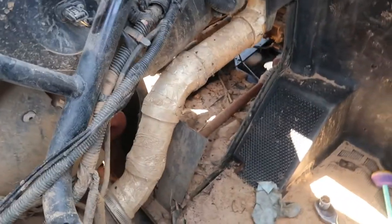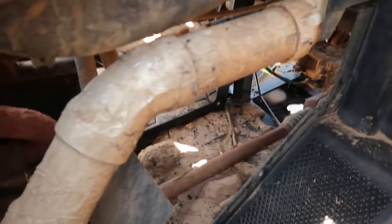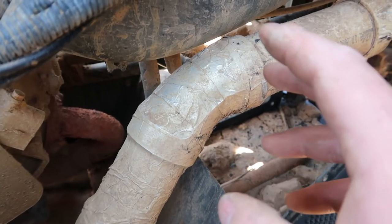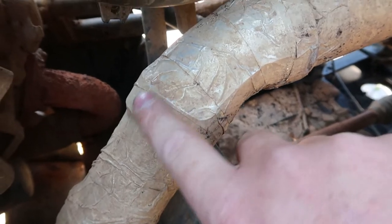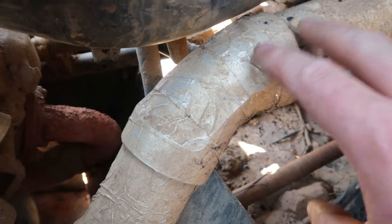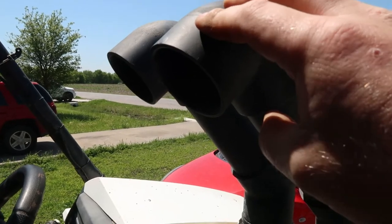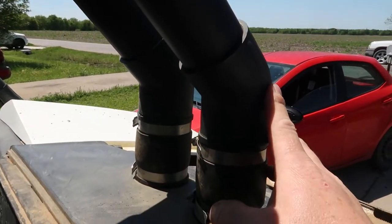In the parts list you'll see mention of water 90s and drain fittings and water fittings. Basically the difference is water fittings are a slightly different size and angle, so for really tight spots they work out really well, and for the risers they just look better. The drain fittings — you can see there's a little bit of a dip and some texture to it. These are usually cheaper at Home Depot. The water fittings — see how it's just real smooth on the outside, no divots — this 90 is a little tighter than the drain ones. Water fittings are a little more expensive but they look nicer on risers.